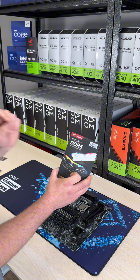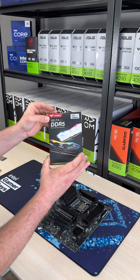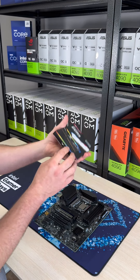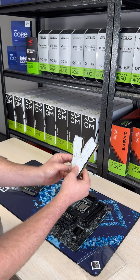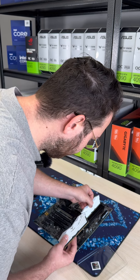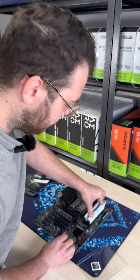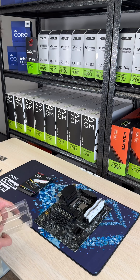Moving on, we got T-Force Delta DDR5 RAM running at 7,200 MHz. This is some of the fastest RAM on the market — incredible — and one of the best things about this T-Force RAM is that it does come with a lifetime warranty. You will notice that one side is slightly longer than the other, and you want to match that on your motherboard. If you put it in the wrong way, you do have a chance of breaking the motherboard. You want to hear those two little clicks. Now that you've heard the two clicks, we know that the RAM is in place and we can move on to the SSD.